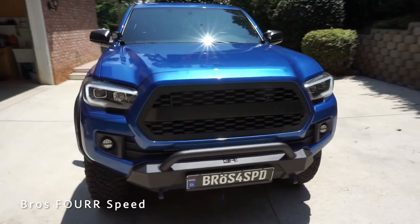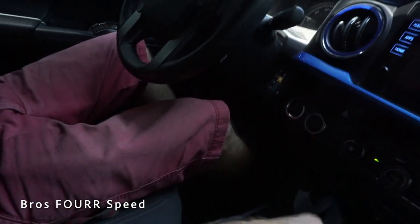That is definitely a nice improvement over stock. Now that everything is installed, here is the brake break-in procedure. You do not want to do any aggressive stops down to zero miles an hour - that's not good. Drive around your neighborhood very conservatively, get up to about 20 miles an hour and just apply the brake pedal without really coming to a stop - basically letting the brake pad material slowly work its way down to the rotor.